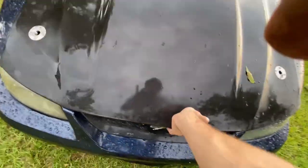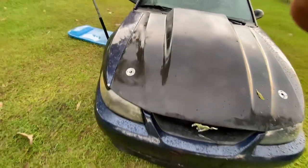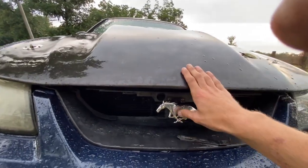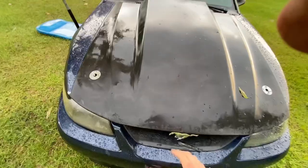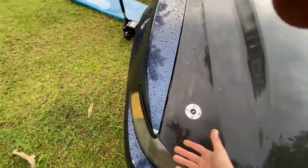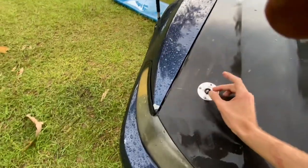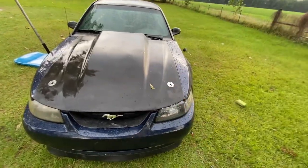I still use part of my safety latch so my hood doesn't ever completely latch with the stock latch. If I were to forget my hood pins, I'd just see it flopping up a little bit and it wouldn't go completely onto my windshield. I very much recommend using the stock safety latch — the body lines are controlled by the hood pins. This is my first time installing hood pins.